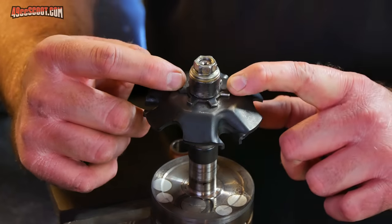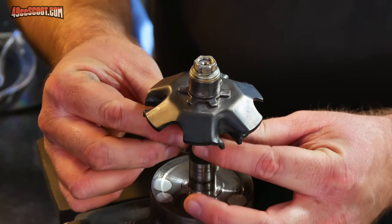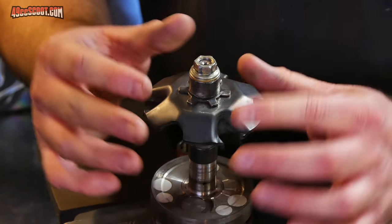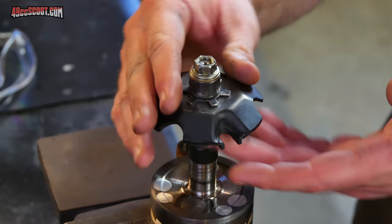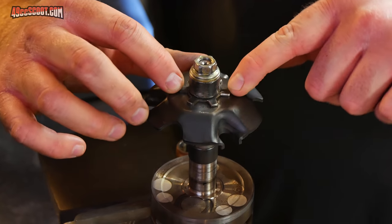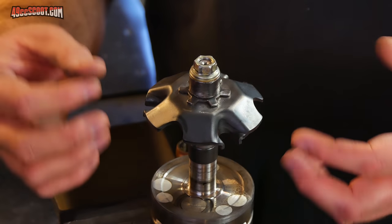My plan is to weld this key to the ramp plate. I've got it mocked up on the crankshaft, with a bunch of spacers in place so I could clamp it down. That way I would know all of the splines are aligned properly with both of them, and everything should be sitting pretty true, pretty flat. But I want to weld this on and see what I've got before I call it done with the spacer, since I do have to press it out, etc.